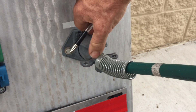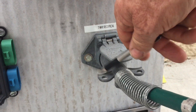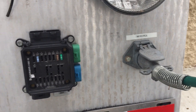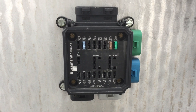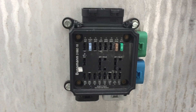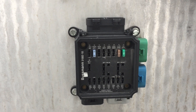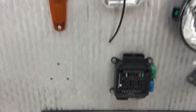This is the plug you use to connect the tractor to the trailer — through this plug all the lights on the trailer will work. And here in the middle is your fuse box. It's located in different places on different trucks, but if you have a light that's not working you can check the fuses to see if one is burnt out. You can also change a light bulb — we're supplied with spare lights in a kit so we can make these repairs.